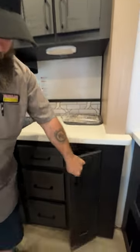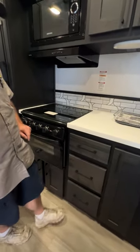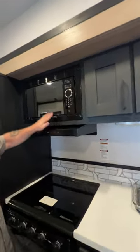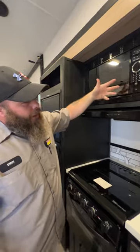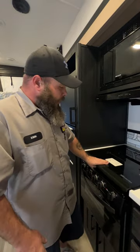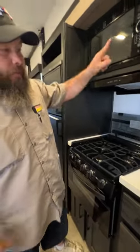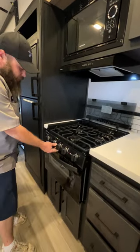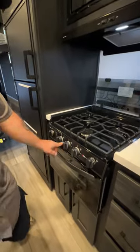Space cabinets up here and down here, then you've got your three drawers. These guys here are actually going to be for your oven — we'll talk about that in just a second because it's a really nice feature. We've got our microwave — pretty self-explanatory. If you come back and the timer isn't set, that means there was a power failure — check whether that was from the campsite or the electric company. Then we've got our hood range with a light and fan. For that fan to work properly, you do have to make sure the vent outside is open. For the stove, you would just turn this to the light position — that's your top-burner spark to light — and once it's lit you'd set to your desired temperature.